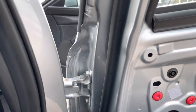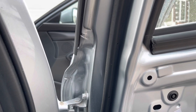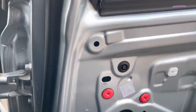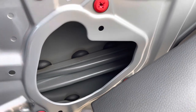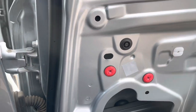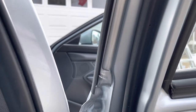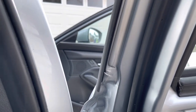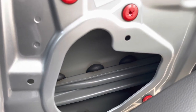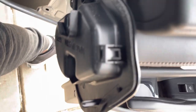On the stock front speakers it's already bare metal in the back so you can't go further, meaning on the front speakers you're definitely limited to that 1.5-inch depth. On the rear door, if you take off that bracket, you're not limited to the 1.5-inch depth. The total speaker overall is about 2 inches tall, so when measuring your speaker, if it gives you top-to-bottom that's the overall depth — about 2 inches — but 1.5 inches is from the mounting surface to the bottom of the magnet.